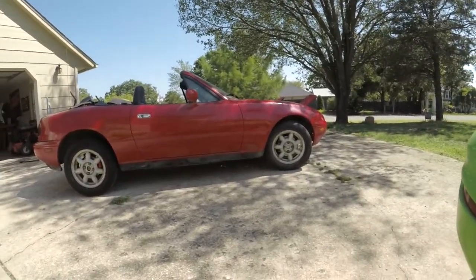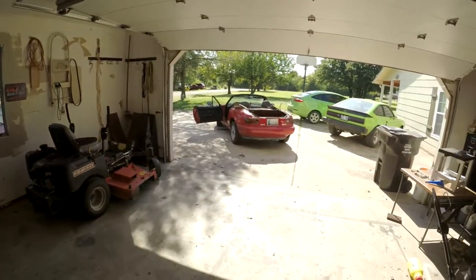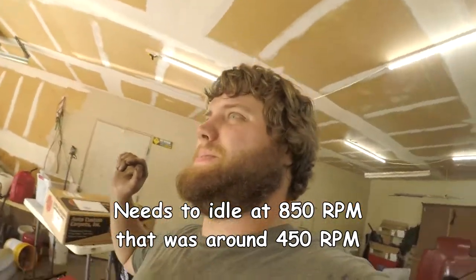She runs! Hell yeah. I'm going to let it idle for a bit and come back. She's a tad bit too loud out there, but boy does she run. I am relieved. Happy that I'm done - I mean, I still got to do the timing and some throttle response, it's idling too low. It's got its own computer, which is interesting - when you push it into gear it should idle up automatically. All that's disabled right now and I got to tune that in or plug that fuse in. Little Miata lives. There's a wasp - I'm walking backwards.